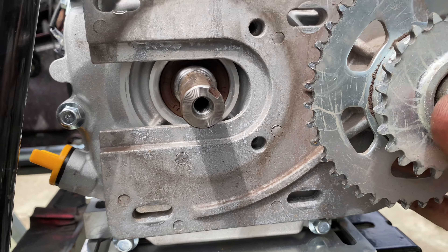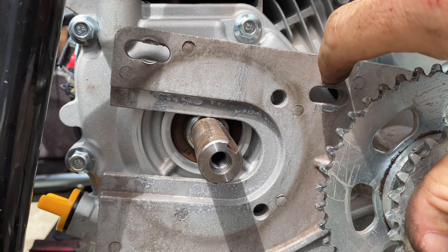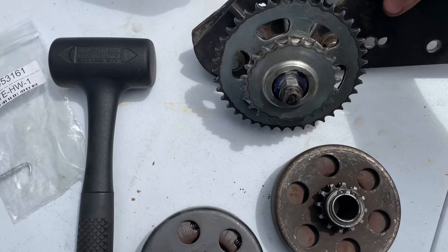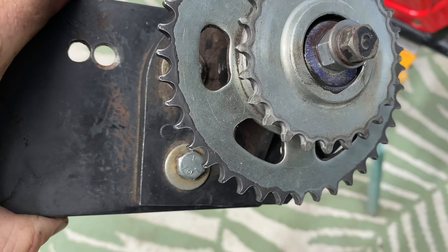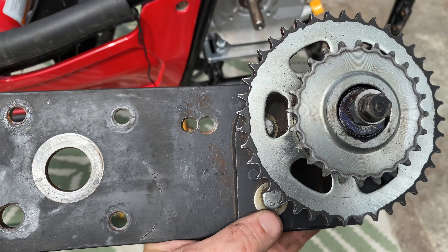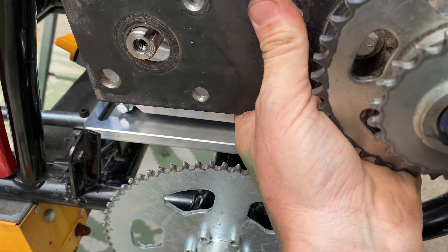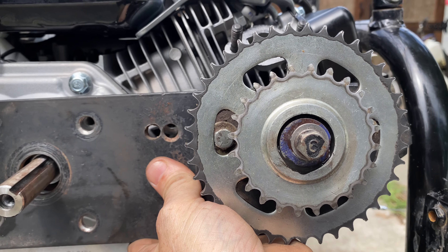We ran Silas's like that for probably a month before this cast piece split all the way down. So once that happened, I smoothed out where it broke, drilled some extra holes through it, and then made this mounting plate. These are hollowed out in the back so I can adjust the chain tension between the clutch and the jackshaft gears, and then it mounts right on to the engine solid with all five flush mounting points.